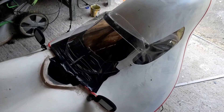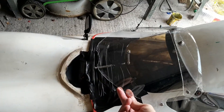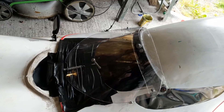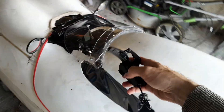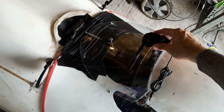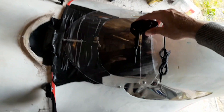Today, I want to install a wiper on the windshield and modify the latch that will hold the windshield in the position I choose. This is how I'll install the wiper designed for a motorcycle helmet, which I bought on AliExpress. It runs on 5 volts via USB and will wipe my visor. I need to route the wires internally, connect the power, and install a switch for control. That's what this video is about.